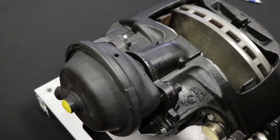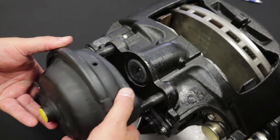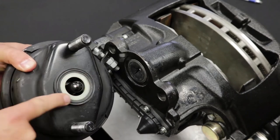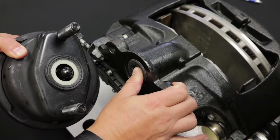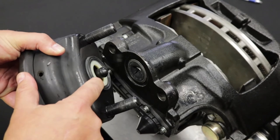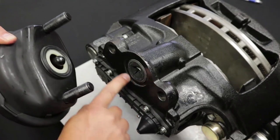Chamber Removal Inspection: when removing a chamber, use a 15/16 open-end wrench. Inspect the mating seal and test chamber function. Visually inspect the mating surface of the seal for wear and heat damage. The chamber seal should be at least 120 thousandths of an inch thick. When reinstalling the chamber, apply a small amount of white lithium grease around the seal.